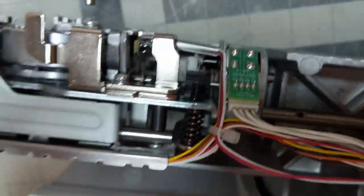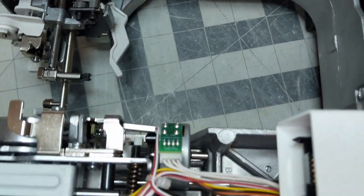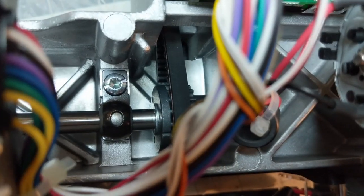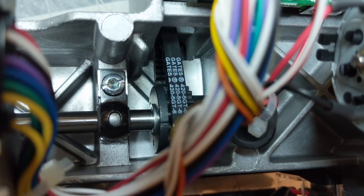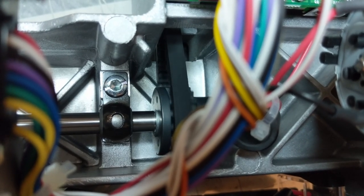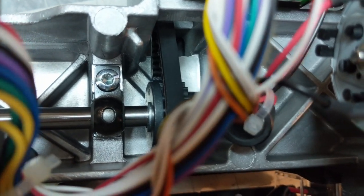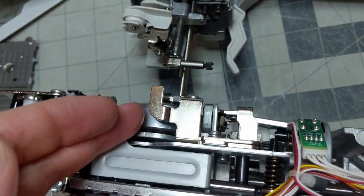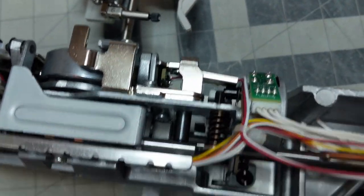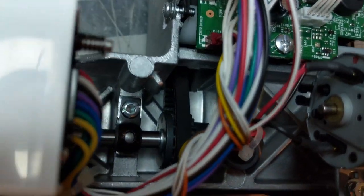You also have a couple of different motors here. This is typical of what you're going to see for these machines. In this case you have an actual belt-driven hook. So the timing could possibly be off on one of these machines because it's belt-driven — if you skip one of those teeth then you could have a timing issue. Some electronic machines have the hook driven by motors or a separate servo system, and those are really never going to be out of time. This one could be out of time if it skips something on the belt or if one of the gears slips on there.